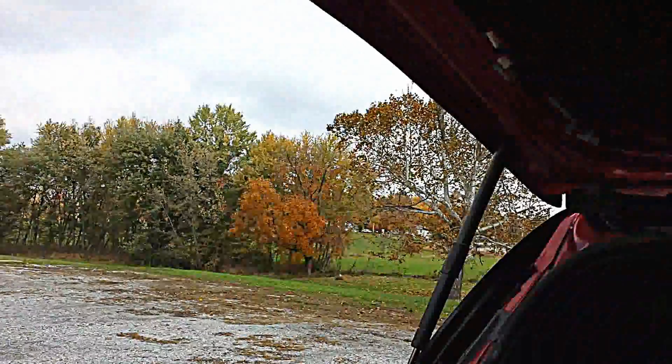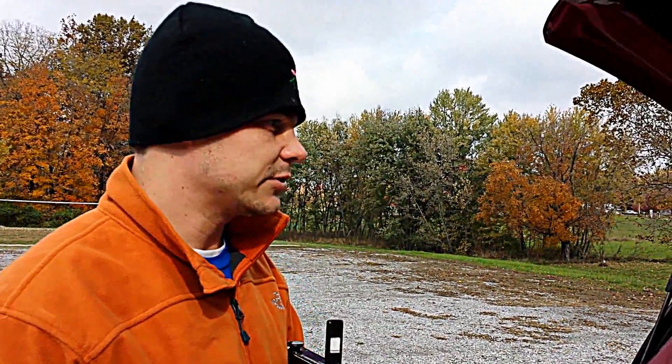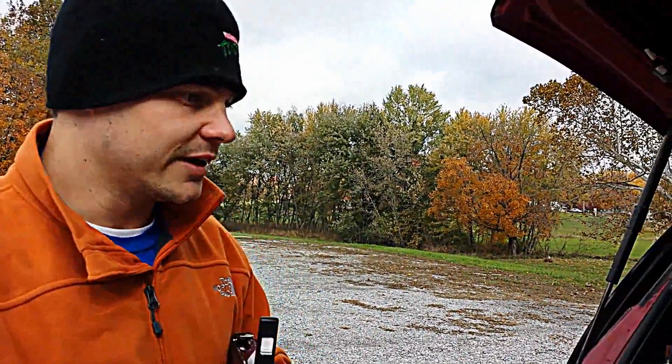All right, that was full tilt. What did we get to? 14.6. We got all the way down to 14.6, which is very good on these amps. And they're already back to 15.0 — we'll watch them recharge. Now that really hit those caps hard, and we were drawing lots of current right there.